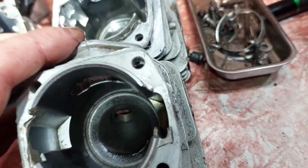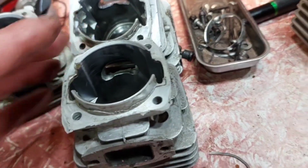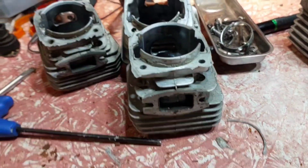If you go to the 2-transfer cylinder, it's got a really big combustion chamber. So that's why there's no power, there's no squish. And the reason for that is you really can't have too much compression on a small saw that's light. The flywheel does help. The piston goes down on power, but you need to spin it back up again. So if your flywheel is too light, you can't have much compression. Otherwise, it's fighting against itself and it can't spin up. There's a point of no return. You can't go too much compression, otherwise it just doesn't work.